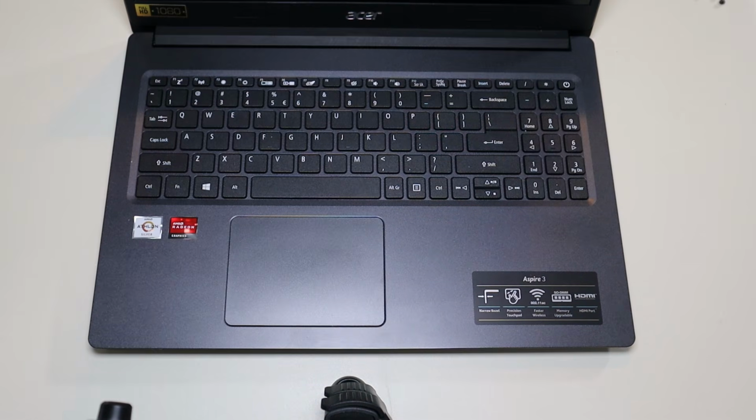Try turning on the computer. If that works, maybe your charger's failing and you need to replace it. If that whole testing process did not get your computer to turn on, then we're not looking at a simple power buildup issue. We'll have to move on to another troubleshooting step.